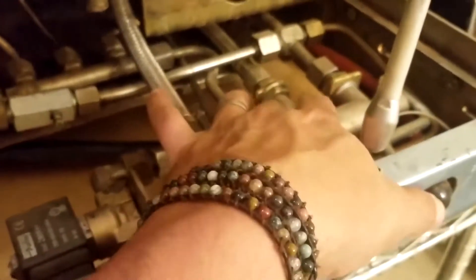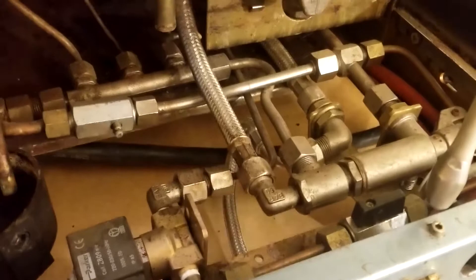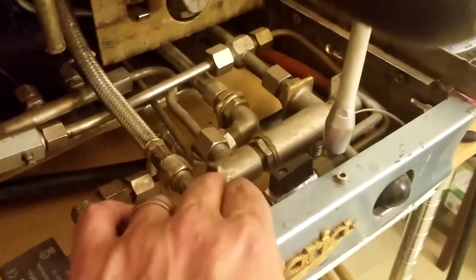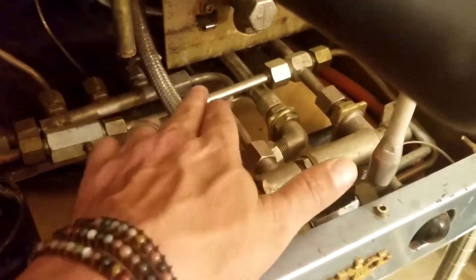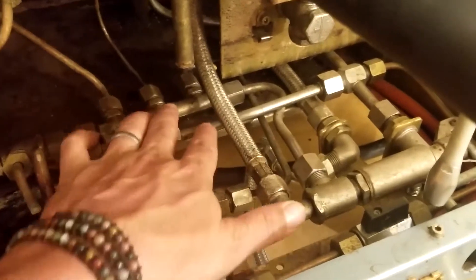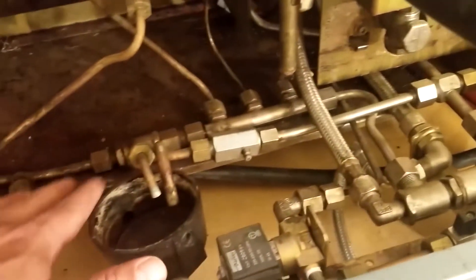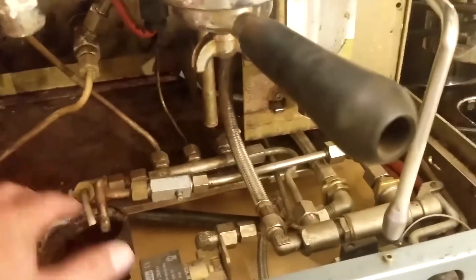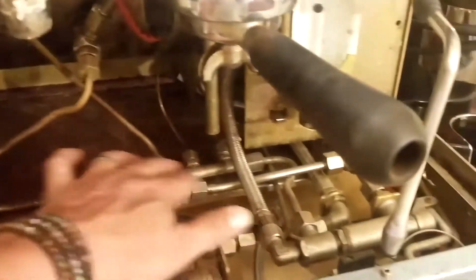This is my water coming in. You're going to see it come in right through here. It comes in here, and the first thing it does is it connects here and it splits. The first split goes to the lower hydraulic assembly — it shoots cold water up into your group heads, moves down here, and gets resisted before it goes into the flow meters. That's the first step in the low hydraulic assembly.